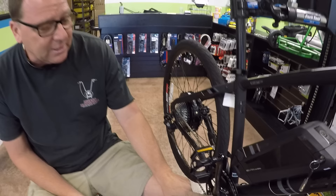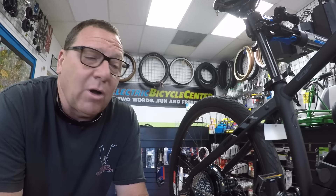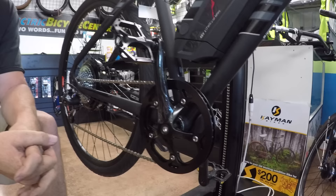When prepping your bike out of the box — on certain manufacturers, your bottom bracket and crank set bolts are not tight, and you've got to check those with an Allen key to make sure they're tightened. On a yearly basis we see somewhere between 15 to 20 bikes where a customer takes a brand new bike and the whole pedal crank falls off. We've gotten that number much lower by prepping the bike, and you as the owner should check that as well once in a while. On some mid-drive bikes, the motor sensor wire comes in right at the bottom bracket, and if it's not tight it can twist and cause damage.